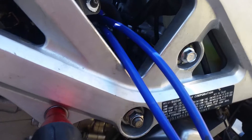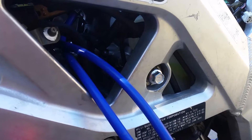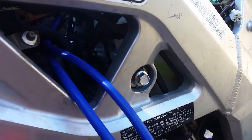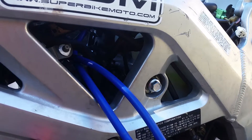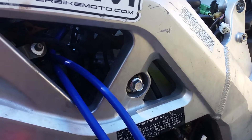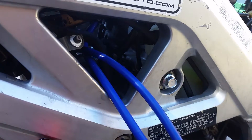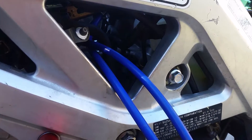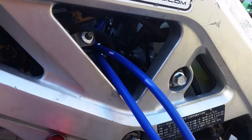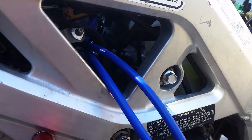I got a new bolt and put it in, and instead of putting in 30 or 40 foot-pounds I only put down like 20 to 25 foot-pounds, because there's less thread engagement left in the engine block. When I was hammering on the threads taking out the broken bolt, it probably damaged the threads even more, so I didn't want to jeopardize that.